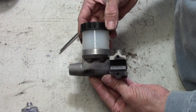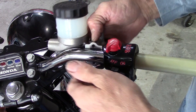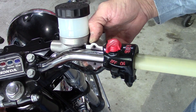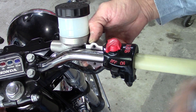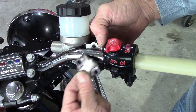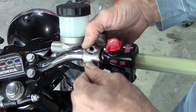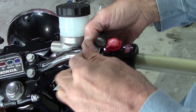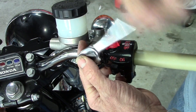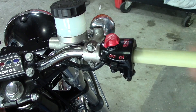That is a fully rebuilt master cylinder ready to mount up on the handlebars. We're ready to mount this up — keeping in mind the angle for the brake lever. There's a little bit of a notch on one of them; I'm going to put that down because it kind of helps with that wire harness where it comes out of the combination switch. I've got a couple of 6mm bolts that are going to go in here — I'll just leave these snug for now and adjust it later.